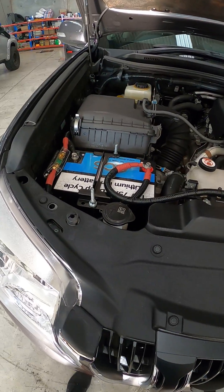These get charged straight off the Toyota alternator — no DC-DC needed. The Toyota alternator is probably pumping out about 100 amps, maybe 30 to 40 on idle, so there's no point going into a DC-DC wasting all those amps. Twin lithiums, alternator straight to them — you're going to charge in no time.